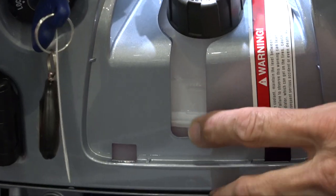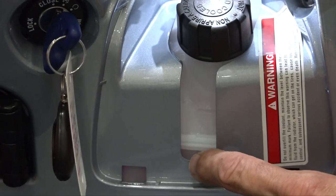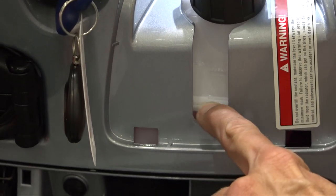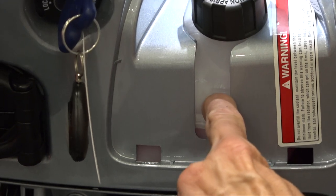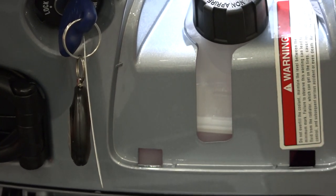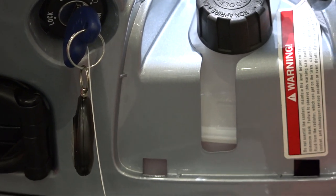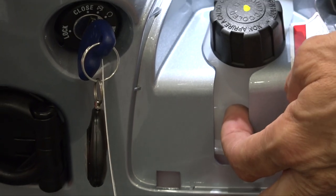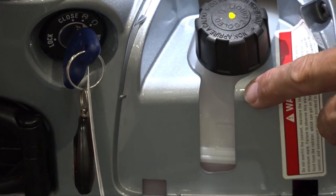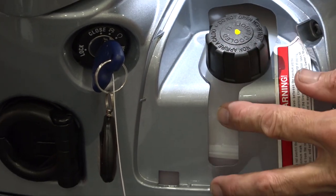This semi-transparent nylon container has a pair of lines that are visible externally. We'll remove the cap and shine a light down so you can see it more easily. The lower level is pretty much at the seam of this container, and the upper level is about a half inch or 12 millimeters above that seam. When it's cool, you want the coolant between the lower and upper levels. If you top it off, bring it right up to the upper level — no more — because on a hot day the coolant may expand and leak out of the cap.